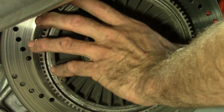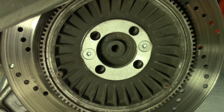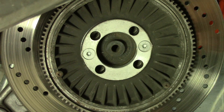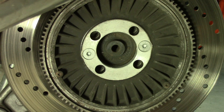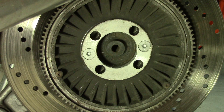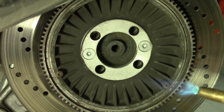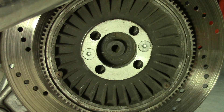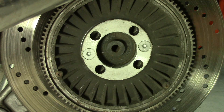Back over to this side. Now the disc and the ABS ring assembly needs to come off, and that's held on with these Allen head bolts. They are Loctited in with some of that wonderful BMW Loctite stuff. You have to heat it up — heat that bolt to about 250 degrees Fahrenheit. You could use a heat gun or a MAP gas torch. I've got a fan blowing just a little bit of air through here, so any accumulated gas fumes or flammable stuff like that is just going to drift away from the flame.